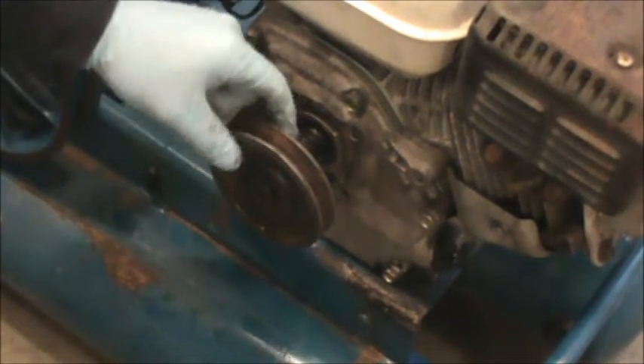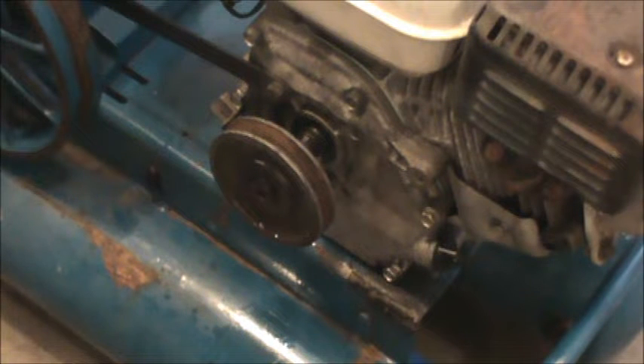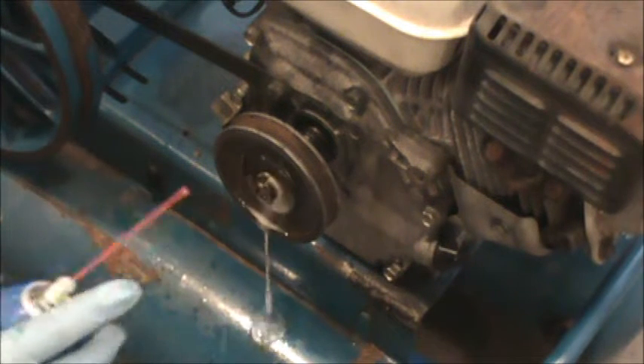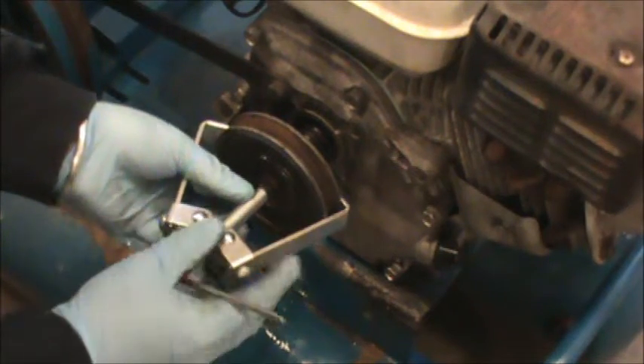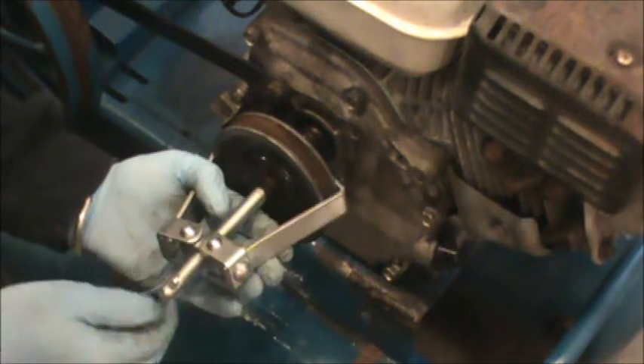My first problem is pulling this pulley — it is rusted on there. I was able to free up the locking Allen nut on the back of the pulley. I sprayed it with WD-40 and I'm going to take a socket and try to tap it forward. It's not moving at all — you can see how seized that thing is. There we go, I got it to budge. Once it's moving, I'll add a little more WD-40 and use a two-jaw puller to slide it out. It's moving now, so I'll work it off.